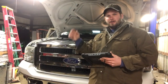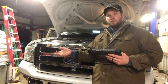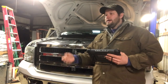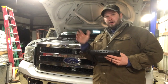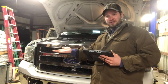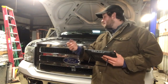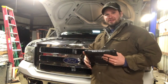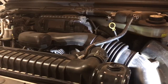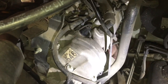These codes could be on either bank. Some quick stuff: this system runs off of oil pressure, so get the truck warm to operating temperature and check oil pressure. Before that, pull the dipstick and make sure the correct oil level is in there and check the condition of the oil — it could be this simple stuff that causes these codes. Check the oil pressure first, and I'm going to remove the air intake.